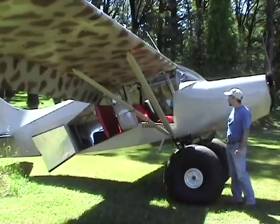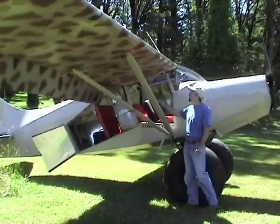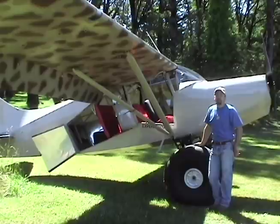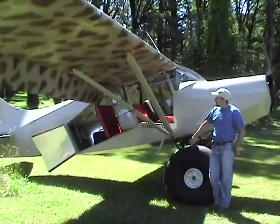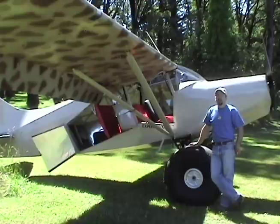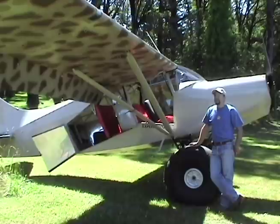The airplane has a custom carbon fiber cowling, titanium firewall, and titanium egress tunnel. The floorboards are fiberglass with a Nomex core. It has really lightweight seaplane doors with polycarbonate that is 80 thousandths thick, making them light and strong with a hard coating so they don't scratch. The airplane has 50 degrees of flaps, an extended baggage area, and a metal belly to keep rocks out of the fabric. It has a very basic instrument panel: a comm radio, engine instruments, and a Garmin 296. The airplane flies at 90 miles an hour top speed and lands at 40 miles an hour. It's a very capable airplane and very fun to fly. This is Bushwhacker.